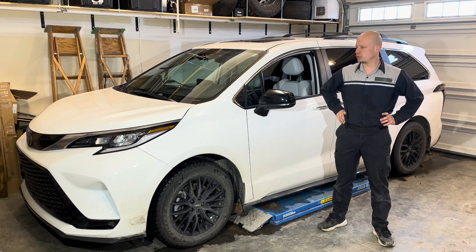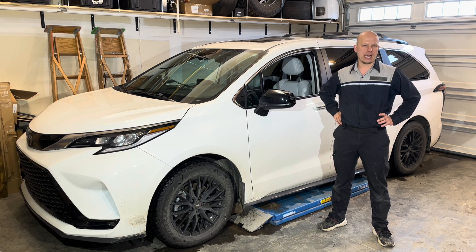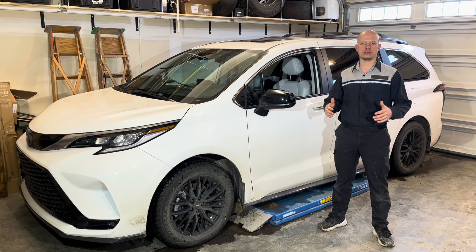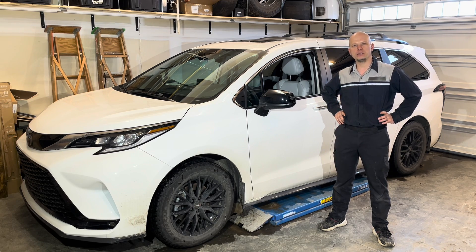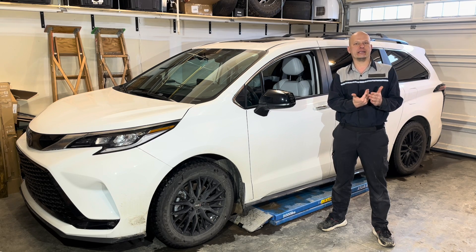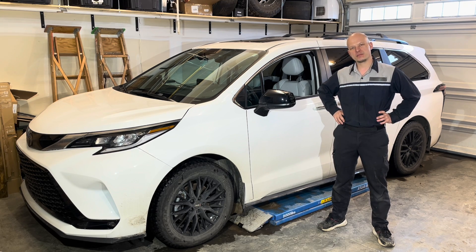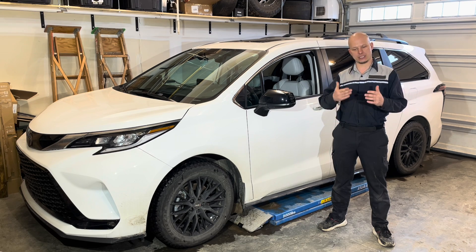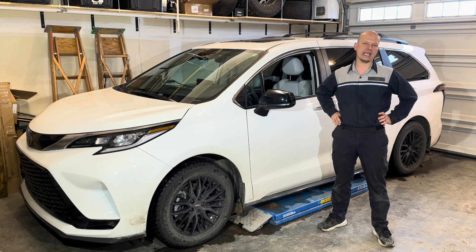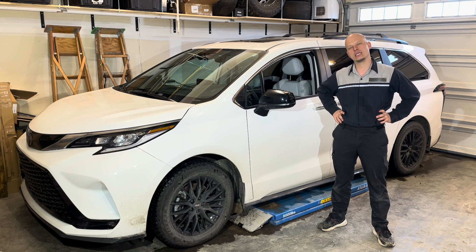Today I'm going to show you how to put this 2023 Toyota Sienna into rear brake pad replacement mode. A lot of people ask me, I already know how to take the parking brake off, so why do I need to do anything else to replace the rear brakes? The problem is that when you release the parking brake, it only winds the motor back a millimeter or two just to take the pressure off the rotor so that the pads are not applied anymore. But to actually change the rear pads and compress the caliper back, you need to wind that rear parking brake motor all the way in, otherwise you will not be able to compress the rear brake caliper pistons to put new pads in there.